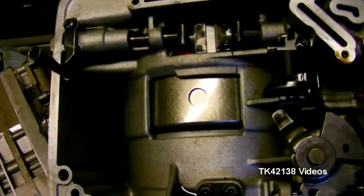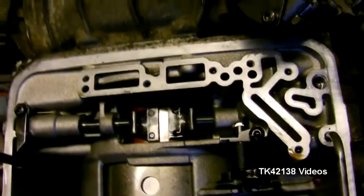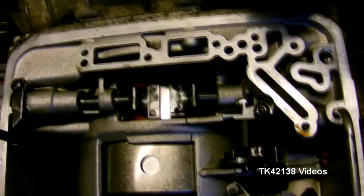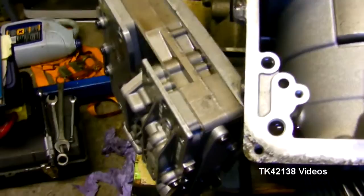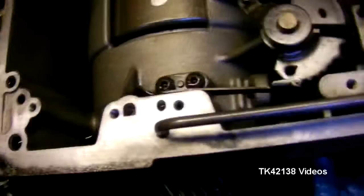I hope you have found this useful. Just because your gearbox is showing symptoms of a worn governor unit, just be prepared — it doesn't necessarily make it only that problem. I had those symptoms on the old gearbox and it wasn't. It was obviously other issues with it. But hopefully, if you're lucky, it will just be the governor — just the governor's seals, the O-rings on the backside. And the car will be back on the road. But on my one, the second gearbox was also playing up despite being rebuilt, and so the valve block had to be taken out and cleaned out. Just hoping that's all it needed.